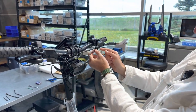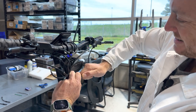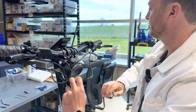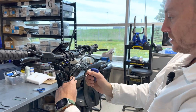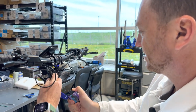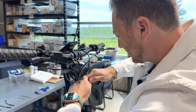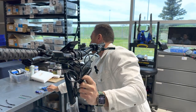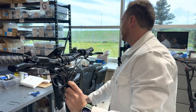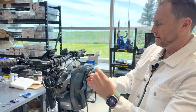Here's the brake sensor, which is underneath at the bottom of the brake lever. As I mentioned, it could be very difficult to remove it. Be careful that you don't pull too hard because you can ruin the wire. Let me demonstrate how to heat it up — take a lighter and go not right on it but kind of close. That should ease it up. There you go, that made it much easier. So now we've got the sensor disconnected.